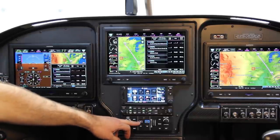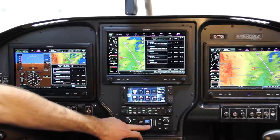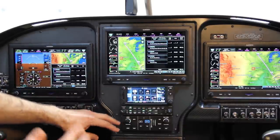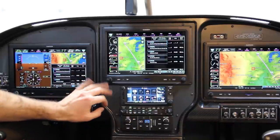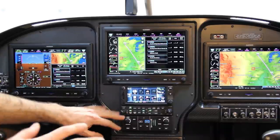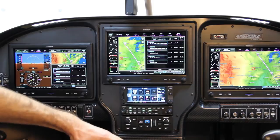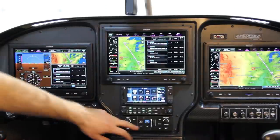You've got your autopilot and flight director buttons — you can have the flight director on even if the autopilot isn't functioning. I've got a button for a yaw damper, which would be a third autopilot servo on the rudder to take some tail wag out of the plane — I don't have that currently but might add it someday. There's also a nice blue level button: even if the autopilot is off, press that button and it will fly straight and level holding attitude and heading. That's also really useful right after takeoff — get up flying, hit the level button, get everything configured, then choose your actual autopilot mode.